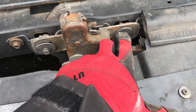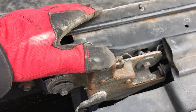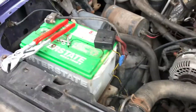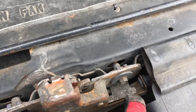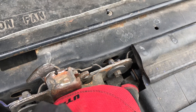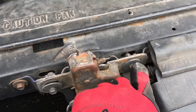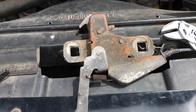In order to put this on, we're going to unbolt these two bolts here — that's what holds your latch to the secondary bracket behind it — and then we're going to flop the latch up here so you have a better workspace, because there's really no way to drill the holes into this to put these bolts on. Keep in mind you can only move it so far because the hood release cable is attached to one side.